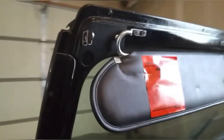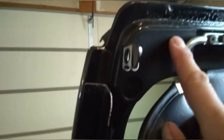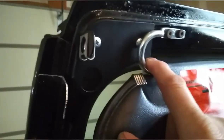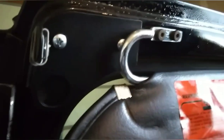We're putting on the super top, so the first thing was to mount these brackets. You can see this bracket with the piece for the bar to go in. They had this little round cutout — I think these may have been for a YJ too, because the YJ has roll bars that come up and connect to the windshield. That extra piece went way out and interfered with my visor brackets. The instructions say to take the visor off, but it would have had the visor uneven, so I just took it to my cutoff saw and cut that piece off so it fits better.